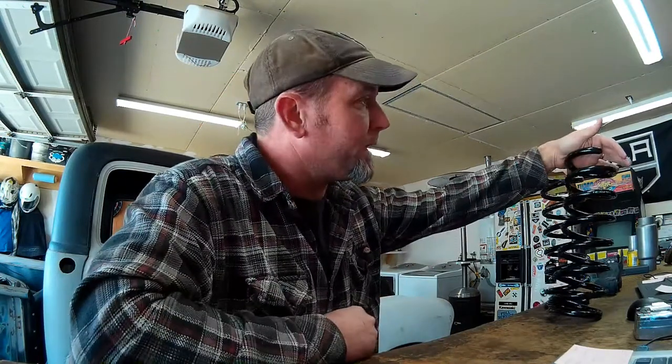There's no way to add coil length. You might be able to use a spacer or something to regain some of that height, but you've effectively increased your spring rate by shortening the length of the spring and it's going to ride like crap. We're not looking for a bouncy lowrider here. We want something comfortable and nice, and we don't want to affect the spring rate any more than we have to. Ideally, I would like to not have to cut the coils at all, and my first install is going to be just the straight coils without modifying them — put them in at full length and see if we settle down to 3 inches of compression, giving us a 10-inch compressed overall length. If that's the case, my measurements of the weight of the P48 are pretty close.